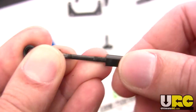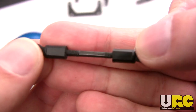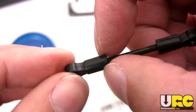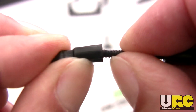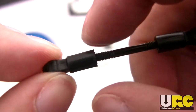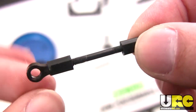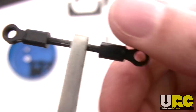This is going to screw right on — you can actually feel where the grease spreads around and just loosens things up. Another thing when you're making turnbuckles: try to make sure you're using the same amount of thread on both sides. When you have extra exposed thread on one side, that means there's less thread going into the eyelet or ball end itself. The less thread you have in there, the more easily it can work its way back and forth — you have more chances of the plastic piece bending, possibly breaking off, or having the threads pull out altogether. Over on the deeper side, it's in there nice and deep and it's going to be very strong. Try to make sure your threads are even side to side.